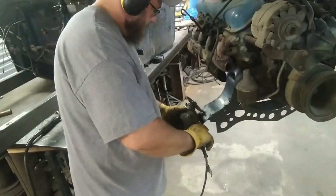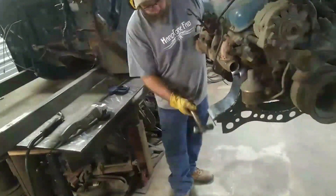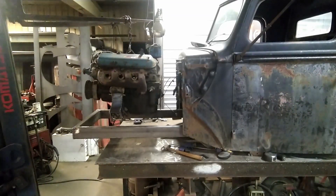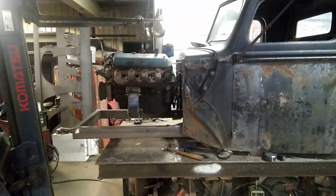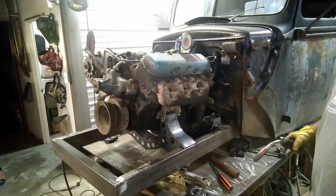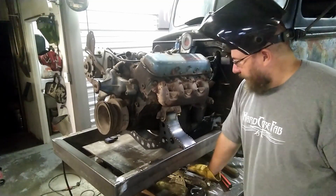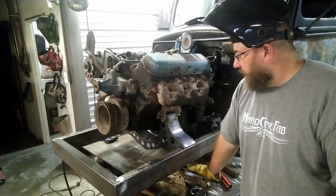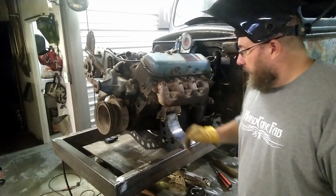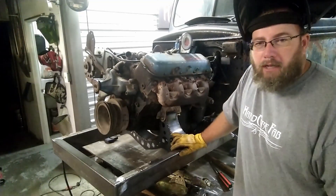Then I stuck the thing up on the motor and everything fit good - fit square and all that like it should. I had a little piece left over that I could cut off and round off that last bit of the edge, and it's ready to go into its final resting place in the chassis. That was a lot of work to get to this point but that thing is looking pretty damn sweet. I still got a couple hours of welding and grinding to smooth up all the edges, but I got it tacked in there - that's going to hold the front of this all together. I think now we can cut the front of this thing off and start on our cantilever arms.